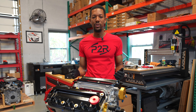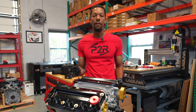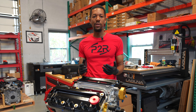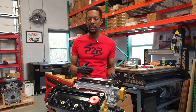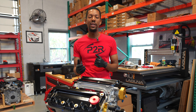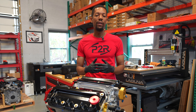We can range basically depending on what type of fuel you're planning to run. If you're going to be an M1 car or a nitro car, even if it's going to be a pump gas or E85 car, the real difference is going to be our compression ratio. A lot of other variables are going to remain the same. This particular customer is not really looking to run any extreme gas, so we didn't chase after an extremely high compression ratio, but we went after all the other bells and whistles.